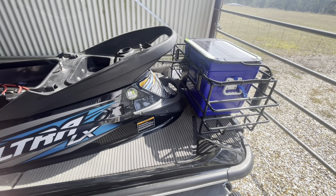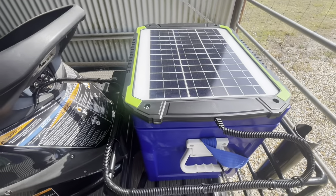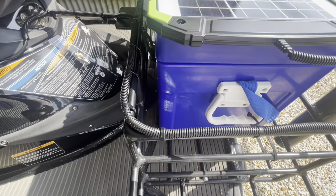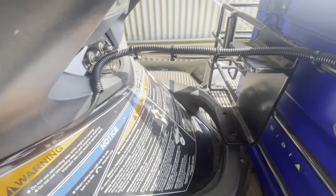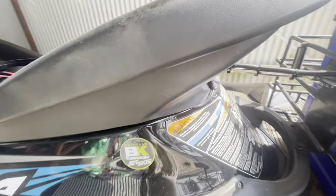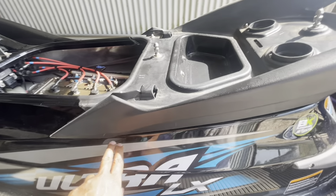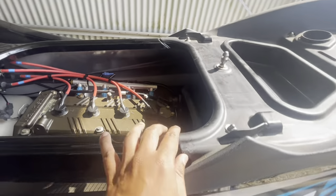Okay guys, I'm all done with the connection and it seems to be working fine. The panel is mounted on the Esky with four screws on the lid. I've put conduit over the wiring of the solar panel wherever I could, secured it with cable ties to the frame carrier. I made a slight change in plan — instead of bringing it under the back seat and making the hole bigger, I've just been able to tuck it under here very securely. There's a tiny little space here which is enough for one single small cable — this is a 2.5 millimeter square cable — and I had to push it in, so it's quite secure.